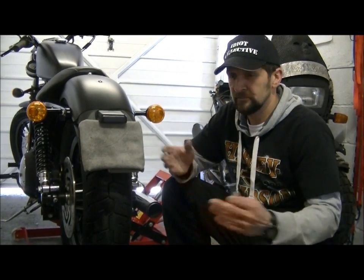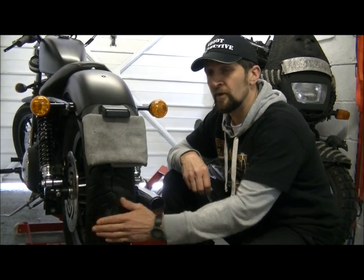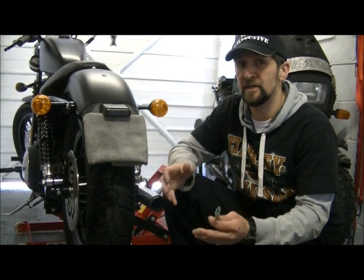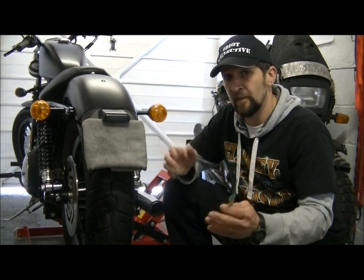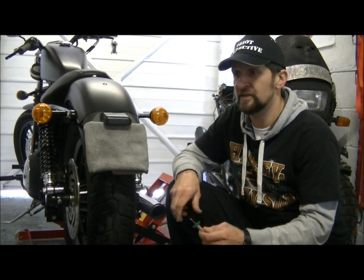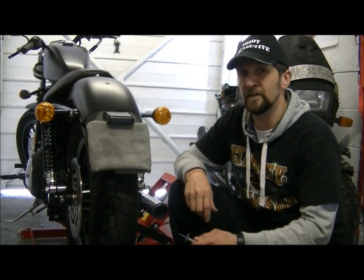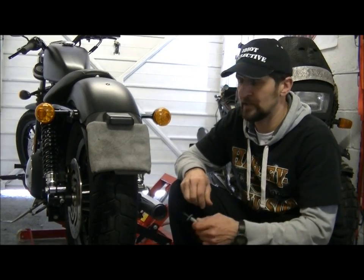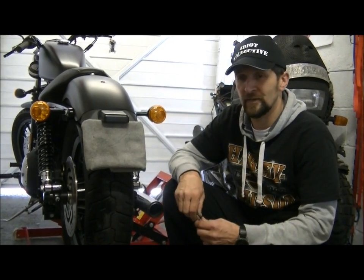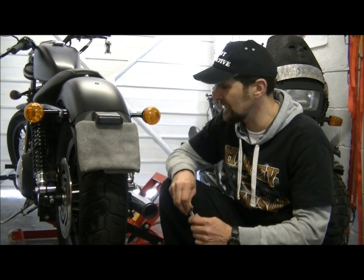Go and do your 5,000 mile tour, come back, even if the new tyre's not worn out, get the last out of it and put the old one back on — you're not losing anything. I'd always suggest changing tyres as a pair, because the age of mixed tyres is something I just don't like. If you're planning a long touring trip, you've clearly got the money to afford it, so don't skimp on tyres — they are your only contact with the planet. Carry puncture kits. Too many people go touring and have to find somewhere in the Ukraine on a Sunday that sells tyres. Think ahead.